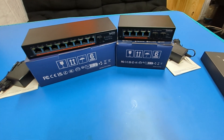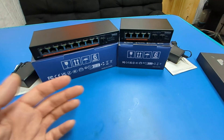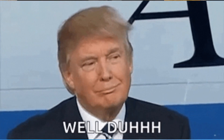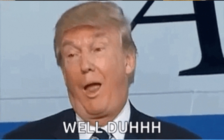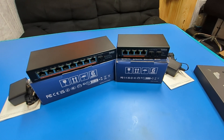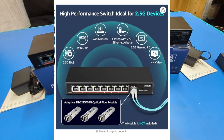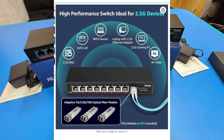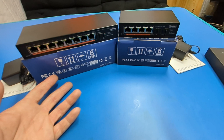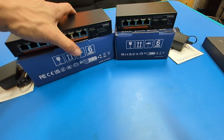Some negative reviews pointed to the 10 gigabit port — it will only work with fiber modules. Most people would say 'duh,' since it's fanless, small, and only has a 1A power supply, so of course you can't run a DAC. But to be fair, nothing in the description stated you had to use fiber modules. Even more expensive MikroTik switches with similar power consumption and port configurations are going to have heat and power issues with DACs — they just won't work — but if you're new to 10 gig, you wouldn't necessarily know that.